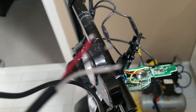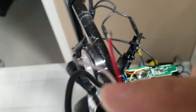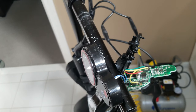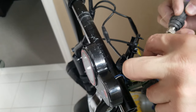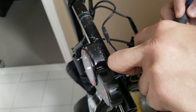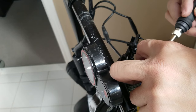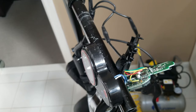All right guys, so I cut the connector off right there and I get the wire ready. I open the end of it and so you guys can see the wire is color coded, red positive, negative, and a signal. And I'm going to solder it temporarily. So make sure that the ignition key is off. You don't want to make some shortage there.